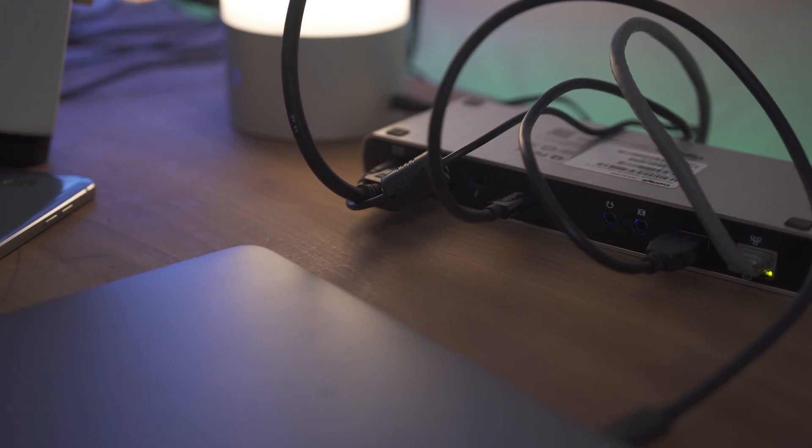There are also audio ports and USB ports. Something really important that a lot of people will find useful is the fact that you can actually daisy chain the LG UltraFine 5K monitor with this dock. So you can plug the dock into your computer over one cable, hide the dock away, and then plug that monitor straight into the dock — all over one cable, which is really awesome. This Thunderbolt daisy chaining capability can also be used with something like a Thunderbolt RAID system or anything else that uses Thunderbolt 3.